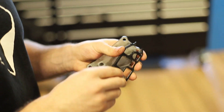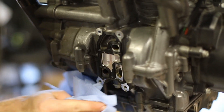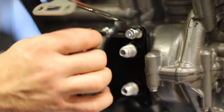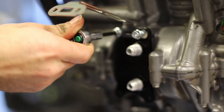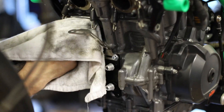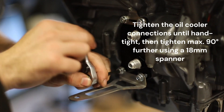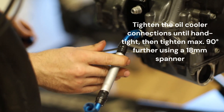We will be using the same oil cooler gasket as before. Clean this up and clean up the position where the oil cooler adapter plate will be placed onto the motor. Place the oil cooler adapter plate as positioned in the video, including the top radiator mount. Then clean the surrounding area and mount the lower mounting bracket for the oil cooler, including the bolts.